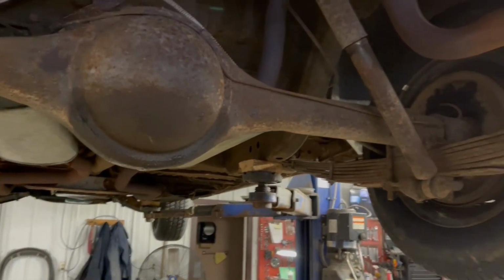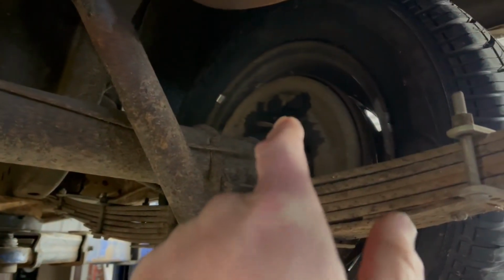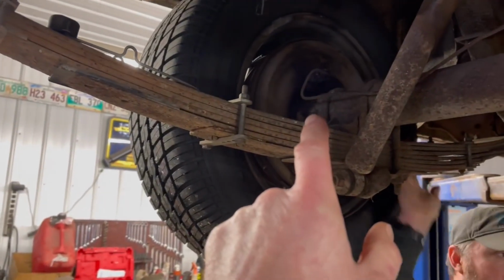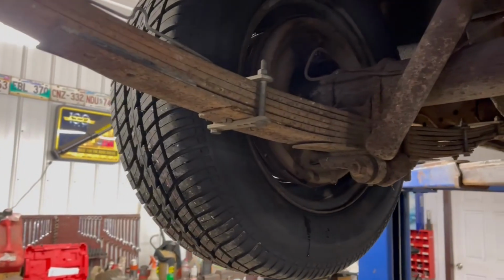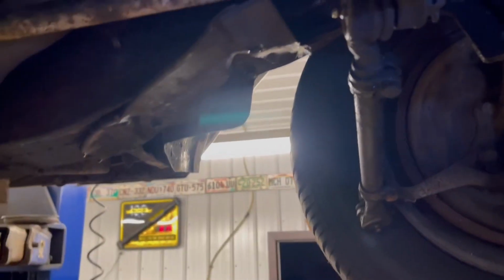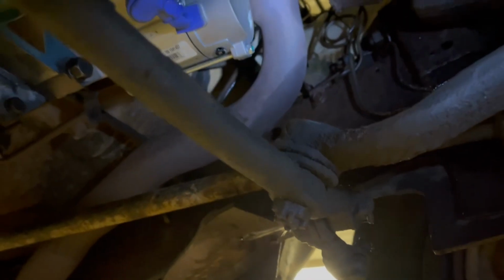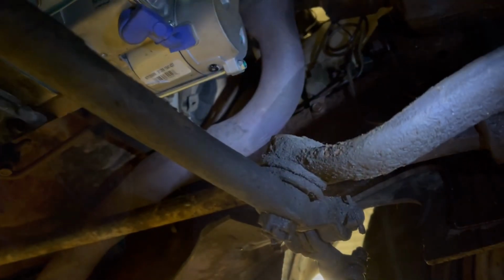After getting the car over here and making sure that we had brake lines, which we did, we wanted to make sure that we had the bleeders would break free. And I guess 3 out of the 4 did. And we've got one over here that we're going to likely have to replace the wheel cylinder. So we're going to call around, see if we can find one of those, and then we can start bleeding some brakes. Well, that was short-lived, and the reason is we think we've got a bad proportioning valve. I don't know if you guys can see that or not.